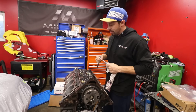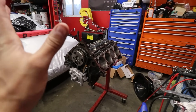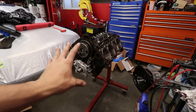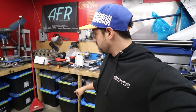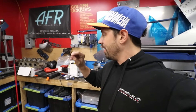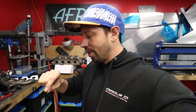The short block is officially complete — besides the timing cover and oil pan, but it's super complete. Next up we've got to do the top end. The cylinder heads were really dirty when I picked them up, so I'm going to take those over to Legacy Auto Group to get washed in the parts washer, then start assembling them — relapping the valves slightly, putting new springs in, then getting them on the block with the push rods.